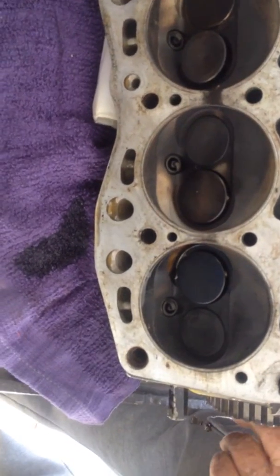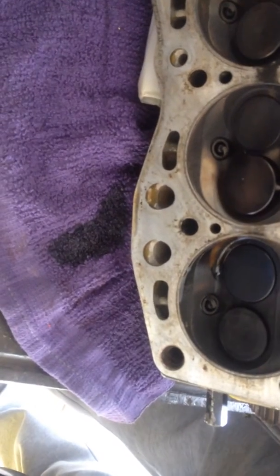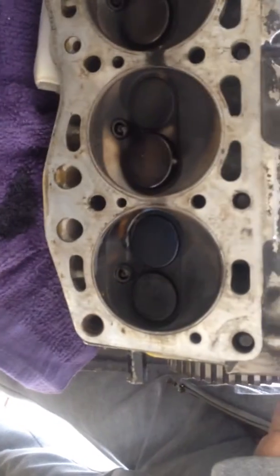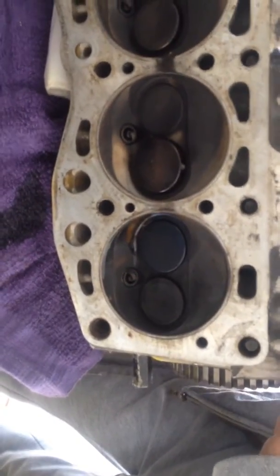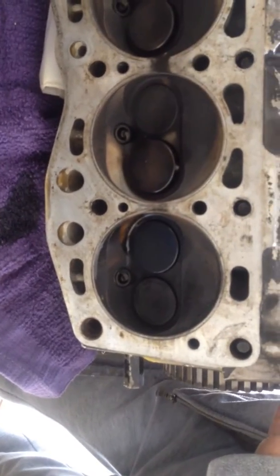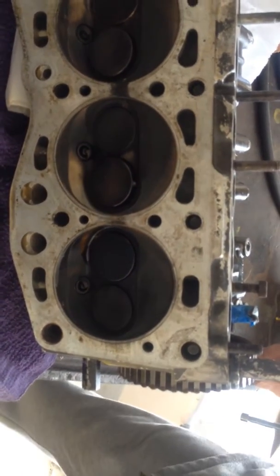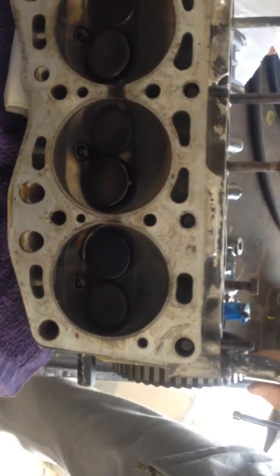So what this is, is just the end of the... notice that exhaust is open? Barely. We'll get them both open just about the same height. Okay, that's top dead center. And this would be completely closed on number four, right? It will be — it'll be completely closed.